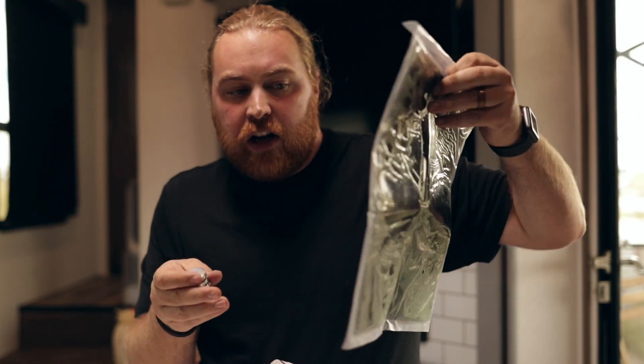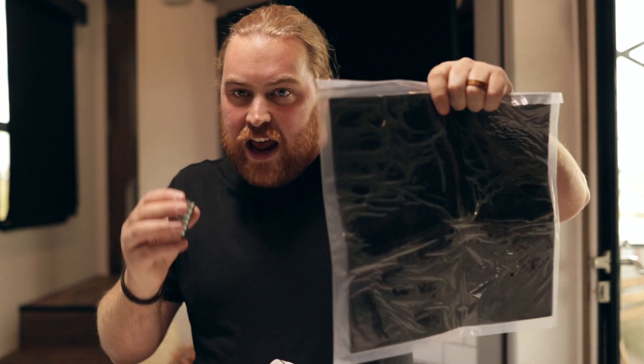The other option is using these magnets. These magnets are optional mounting hardware that come with it — they are very strong. They screw right into the unit, and this way the unit is a little bit easier to remove. If you go with the magnetic option though, I have a suggestion: buy a neoprene sheet on Amazon. This is basically going to go between the vehicle and the magnet so it doesn't scratch and rattle as much. We'll show that on the install, but for today we're just going to show you how to get these magnets on, as they are a little tricky since they are very strong.